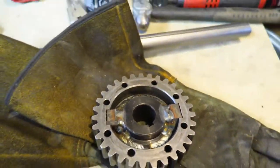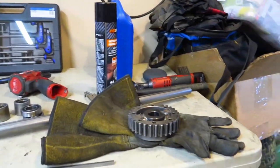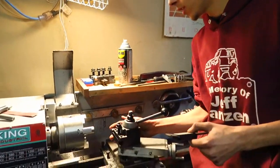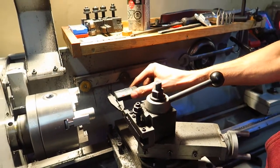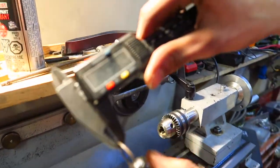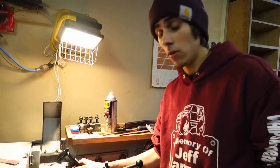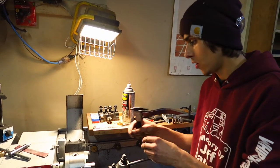That's still hot — boom, nice. You can see it started to slide in too — decent and perfect. Got that all welded up looking awesome, dad's welder did perfect. We also picked up some quarter inch keyway stock because we've got lots of stuff to lock in. Now we gotta cut lock ring grooves onto our one inch keyed axle shaft — it doesn't come with a notch in it. I have a parting tip tool with a 1.8 millimeter tip, and the lock rings measure one mil, so I'll go in with the parting tool taking out 1.8mm of metal, then come back 0.2mm so we can fit two lock rings snugly onto the axle shaft.